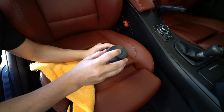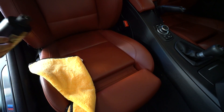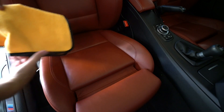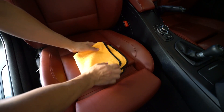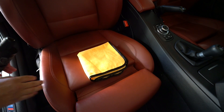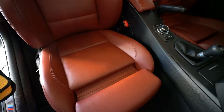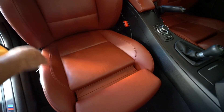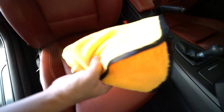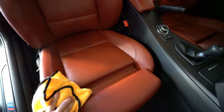What you do with this stuff is you just want to shake it — it's very simple to apply, super easy. Now with any conditioner or any leather or any car that you're doing, you want to test on an inconspicuous spot just in case there are any issues with the dye, or you want to see the result before you do the whole seat. We've already cleaned our seat with a dry microfiber, just taking off all the dust and free dirt.